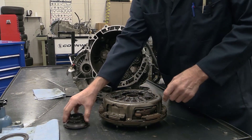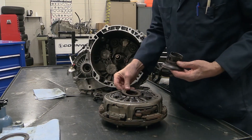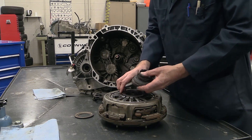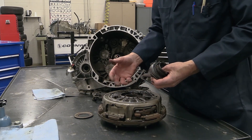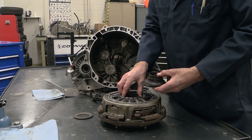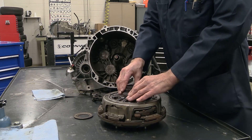The other part of this throwout bearing is released. So this clutch and the shaft it's attached to can now stage the next shift or shift into the next gear. Then a moment later, this one will be released and this set of fingers will be pushed down and applied.